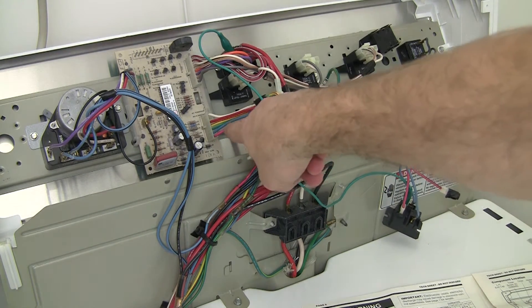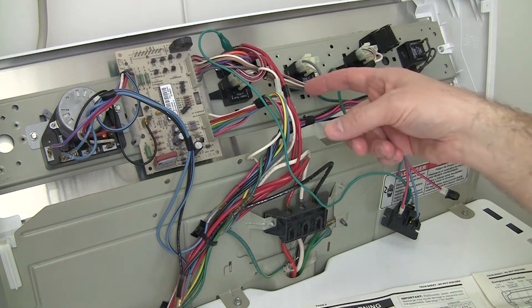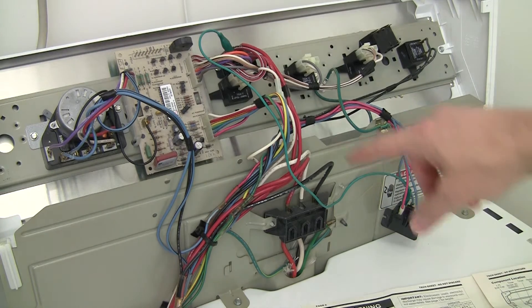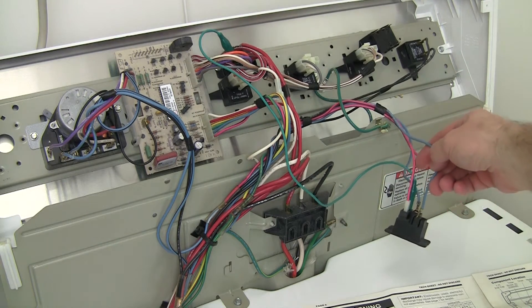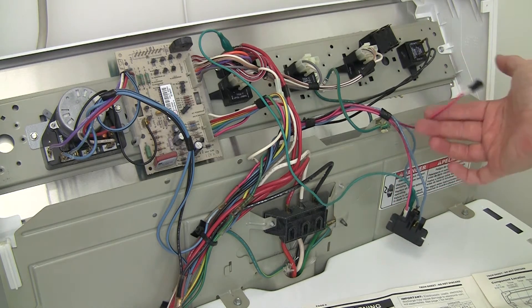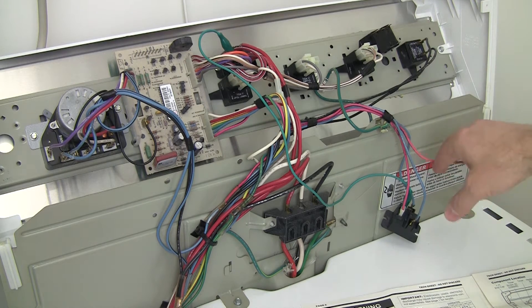The control to turn the motor on and off comes from connector PS02, pin seven — that's the trigger for the motor, and that wire goes to the relay here. The other wire was the 120-volt one that you disconnect. If you get the board new, it will include instructions telling you to disconnect it and tape it off, and you'll have the new harness that works perfectly.